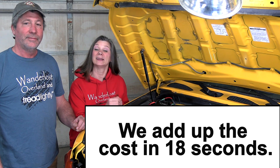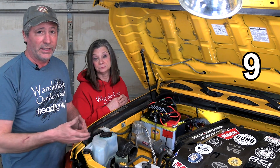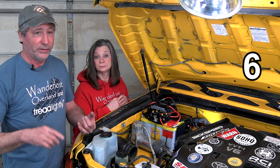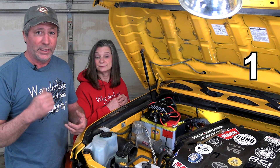When we get it all done, we'll place a link at the end of this video and in the video description. In it, we'll show us running the cables back there, putting in a fuse panel, 12 volt outlets, USB chargers, and a volt gauge. We spent right around $1,100 for our system, but by making your own battery tray, using fuses instead of breakers, and spending a little less money on a battery, you can trim that down to around $750. Now I know that still sounds like a lot, but that includes everything — battery, wires, charger, fuses, everything.